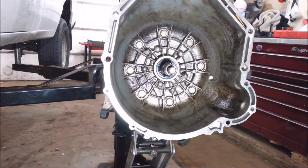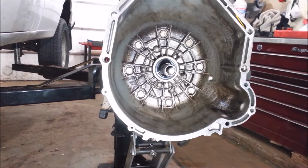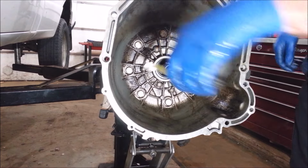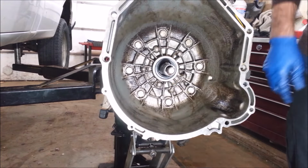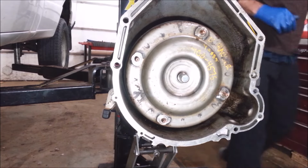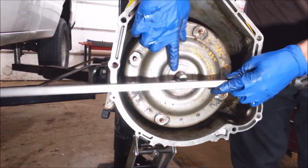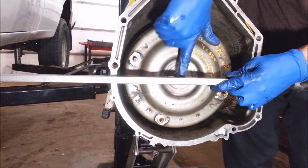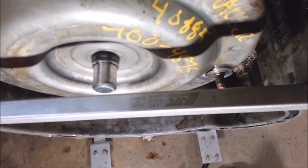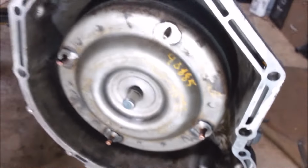I'm going to torque them all at 35 pounds, see what the first one feels like. Probably go a little more, but I'm not going to. Yeah, now the shaft's in about 3/4 inch, so it went in an extra inch. So you'll feel it click in 3 times. Then you're going to want to get a straight edge and measure it. And it's in about a 1/2 inch on the inside here. That's about what it looks like, about a 1/2 inch. So that's right as rain.